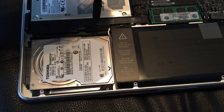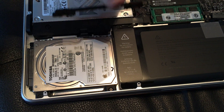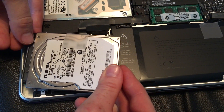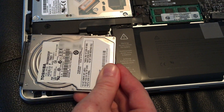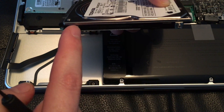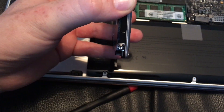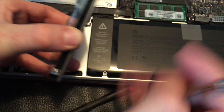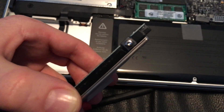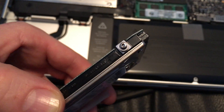Take care of these two screws up here, then pull on this tab — there's a connector right here, so just gently pull that out. It might be a little hard at first but don't pull too hard. We're going to take these screws out to transfer them onto the new hard drive. Note it's not a normal screwdriver — it's a different size from the one used for the outer Mac screws.